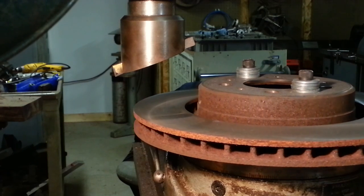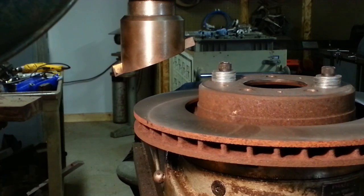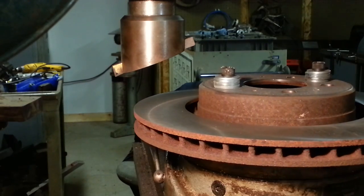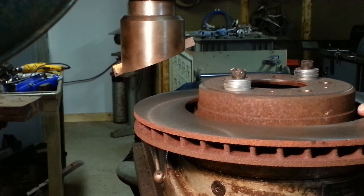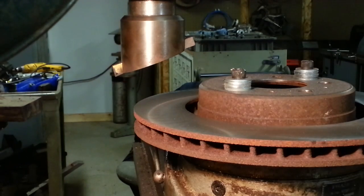I'm seeing some pitting in the metal. I have a feeling that's where the brake pad sat whenever it was parked for a couple of years, because I see rust — there's staining in the cast iron and some rust down in some pits there. That's always possible, although it could be porosity in the casting — that's possible too. Well, we're here or there, it'll work.